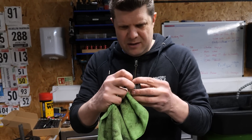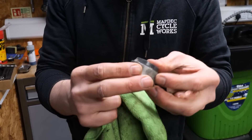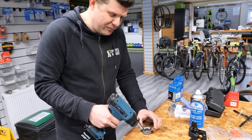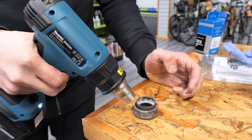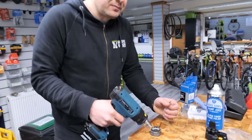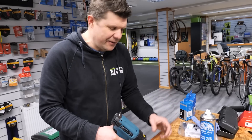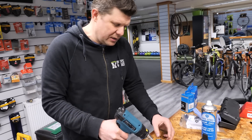The next mission is to get this aluminium cup off without damaging it, and it is stuck. A cordless heat gun - every mechanic should have one, they're amazing. We use this in the workshop for just melting that red loctite that you get in suspension components. It's so easy in the suspension room just to melt down some loctite quickly.